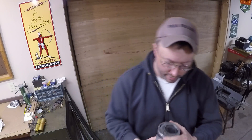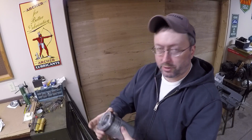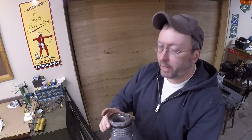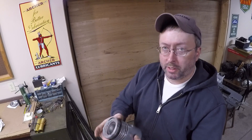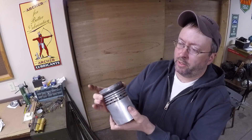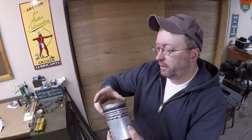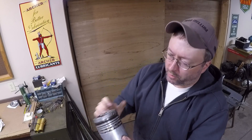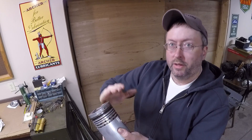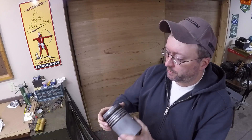Best laid plans — I got this thing about a third of a turn counterclockwise and it just seized right in. It's not moving anymore. I can get a little bit of movement back clockwise but I can't make it come off any further. What I think happened is that where this upper ring land insert had been banging around, it galled or mashed that bottom thread. As soon as I started going counterclockwise, that mashed lower thread came up into the rest of them and seized. So at this point I'm going to have to split it to get it off.